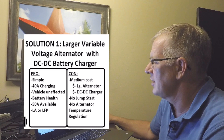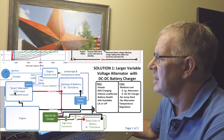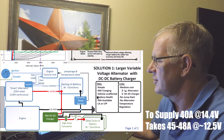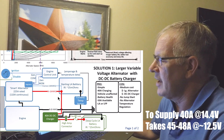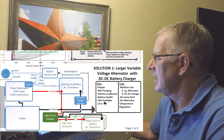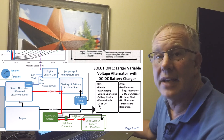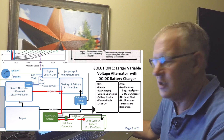Your camper battery gets a complete charge from the microprocessor-controlled charging system, so it should remain healthy for much longer. I've specified this as a 40-amp charger, but there are 50 amps available. The difference between 110 amps continuous and a maximum vehicle load of 60 amps gives 50 amps available as input — and to get 40 amps out at 14 volts, you need to put in about 45 to 48 amps at 12.5 volts. DC-to-DC chargers can compensate for voltages needed by either lead-acid or lithium iron phosphate systems.